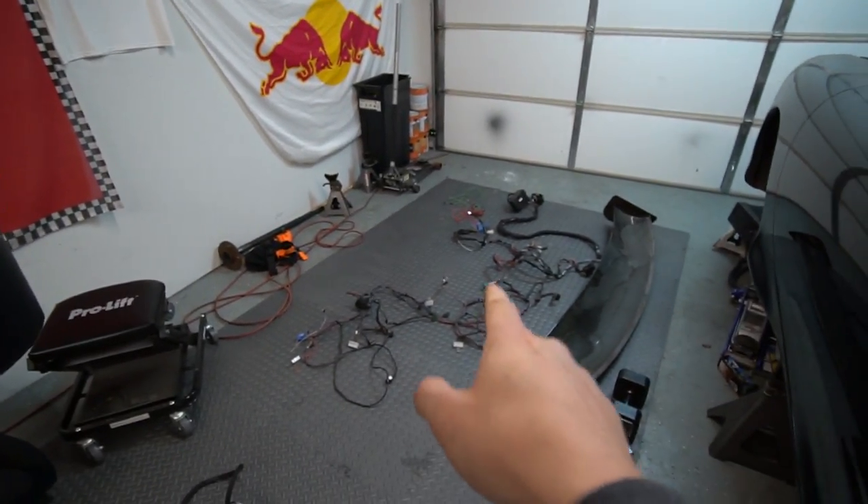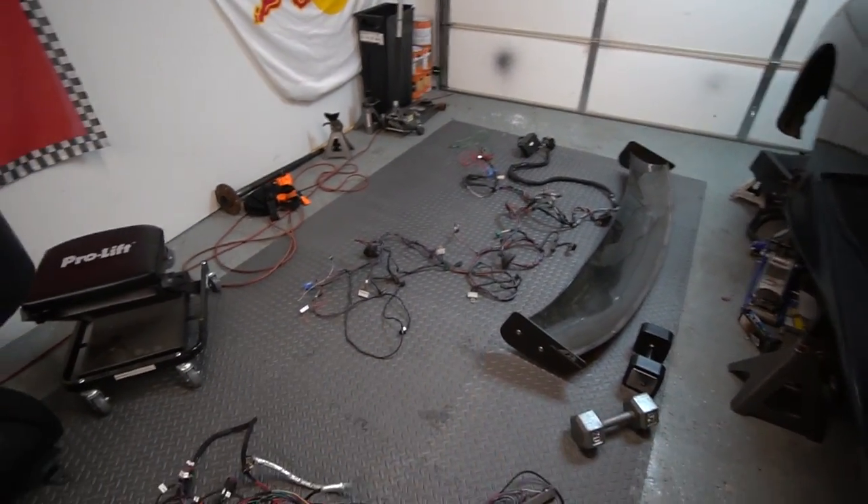So today we're working on the wire harness on the FD. I probably spent like 50 hours behind the camera — if not like a hundred or a hundred fifty hours, I don't even know, I lost count — just studying the wiring harness, how everything works. Basically I'm getting rid of everything I don't need: airbags, traction control and ABS systems. Everything that has to do with emissions has been completely eliminated. And the wiring harness for the body looks like it has lost three times the weight. It has been simplified completely, and I always say simplicity is key to reliability.